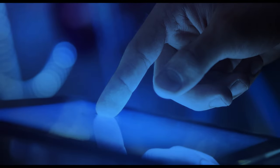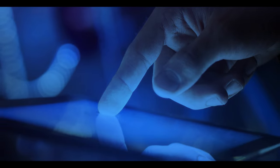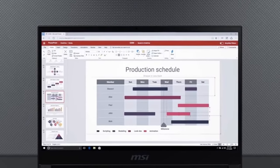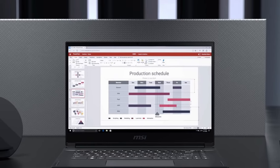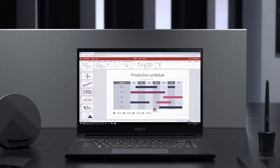Installing our Health Guard profile not only eliminates PWM, but also reduces the harmful blue light emissions, while keeping the colors of the screen perceptually accurate. If you're not familiar with the blue light, the TLDR version is emissions that negatively affect your eyes, skin, and your whole body. You can find more information about that in our dedicated article on blue light. MSI GS66 Stealth's IPS panel has a full HD resolution, comfortable viewing angles, and a good contrast ratio. Moreover, it sports a wide color coverage with 95% of the sRGB gamut, and its backlight doesn't flicker at luminance levels above 71 nits. Below that, the frequency is very high, which is good.